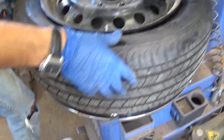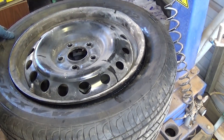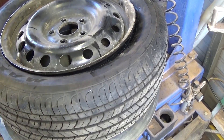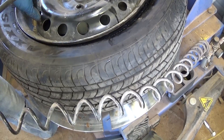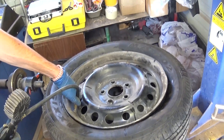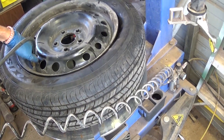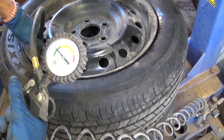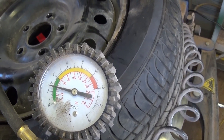All we have to do now is release it from the machine — because if it explodes, we don't want to be holding it there, so get out of the way. We're just gonna put air in without the valve stem needle. It's gonna pop — so stay out of the way, never lean towards the tire, because if it explodes it's going to be in your face. One side is out, second side — good. All you have to do is put the appropriate amount of air in it, and that's the whole procedure. Then you need to balance it.